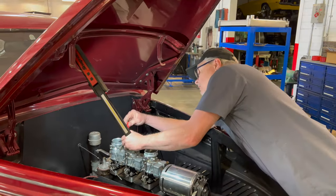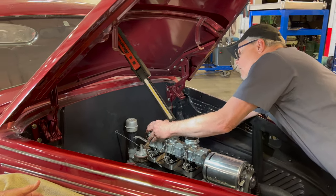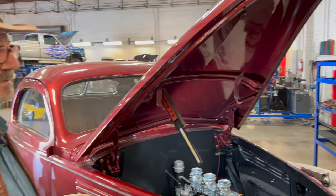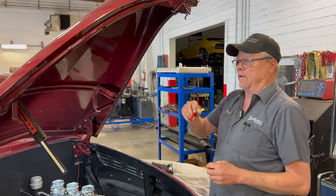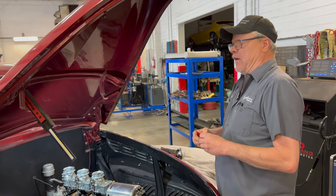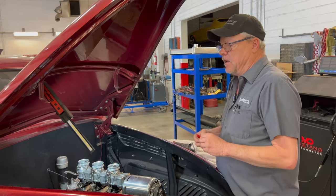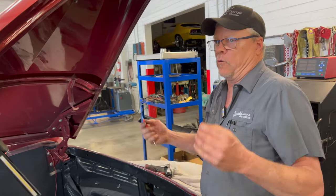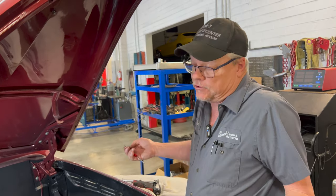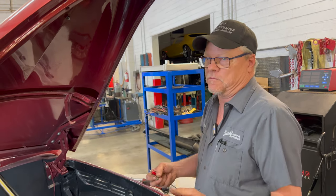Yeah. You know, gasoline is not forever. And we use Sunoco racing fuel because it doesn't have any alcohol in it. So it tends not to go bad in, what would you say, 2 or 3 years probably? Minimum of a year for sure. I've seen cars, back when sand buggies were really popular, they'd only go out in the summer. If they would keep it over the winter, they wouldn't use them. But if you'd keep Sunoco in it all the time, you'd go in the next season, the car would fire right up and you weren't paying me to rebuild your carburetor again. Yeah, exactly. Everybody complains about the price of the fuel. But what's cheaper? You pay me to rebuild your carburetor or spend a few bucks more on fuel?